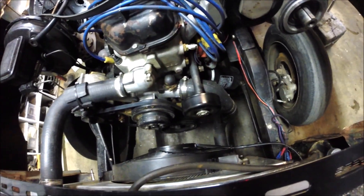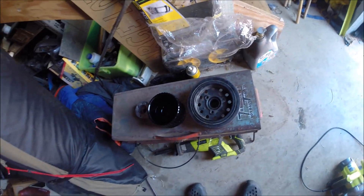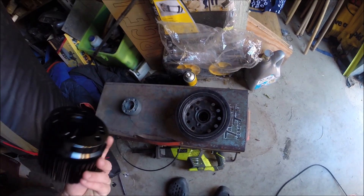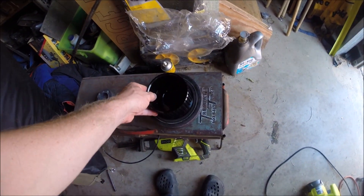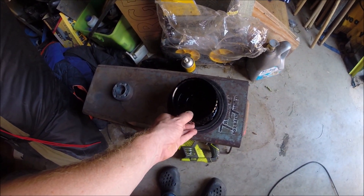The car's all been fixed up and now it's time for the boost upgrade. I ordered a Gilmore pulley kit — actually a kit intended for a Windsor — just because the tooth count was going to be about right for the boost level I need. I've pulled off all the pulleys. Supercharger pulley is gone, crank pulley is off. This is the old pulley that was broken, and this is the Gilmore pulley going in its place. Of course nothing you can buy will bolt straight on — I thought there was a chance this one might, but it won't.